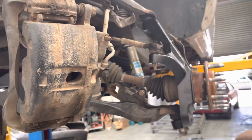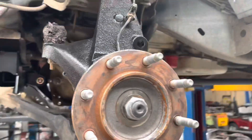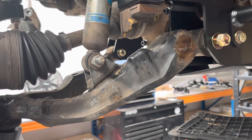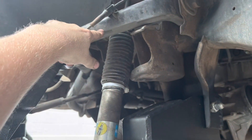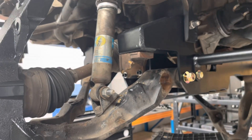I didn't really want to go this big. The 2-inch, the 3-inch — I don't know if they do a 4-inch — but the lower kits are usually just a set of keys. That key goes on the end of the torsion bar, and this allows you to wind the torsion bar up more, which pushes the arm down more. But the problem is the front ends of these trucks are a bit flimsy for the weight of them — it cranks the arms down and then all the ball joints run at funky angles. That's why mine are all a bit tired, because I've been driving around with the torsion bars wound up.